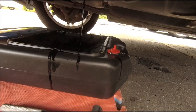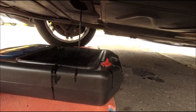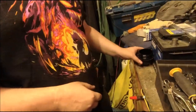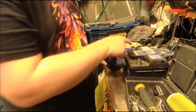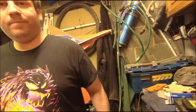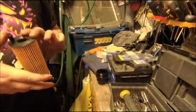Out here I can stick some degreaser on it and get rid of it - that would soak into block paving otherwise. We'll leave that draining. Got the old filter pulled out of the housing and now we're about to put the new one on - put a new O-ring on. Just use a little pick tool to pull it off. New copper washer too - you can heat them up and renew them. Right, let's get the O-ring on.